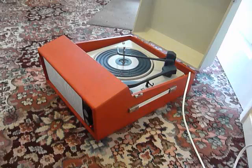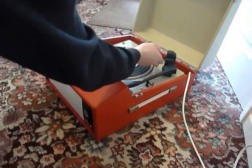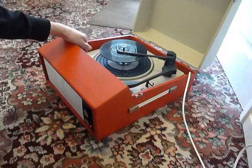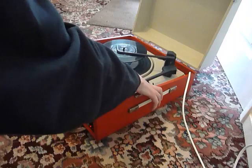You can stack between one and six records. I'll briefly demonstrate with two just so you can see how it plays. Just pop the records onto the spindle and put the stacker arm across, select the speed, and then to start the auto-changer just flick the right-hand control knob all the way around.